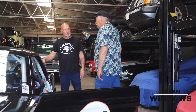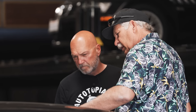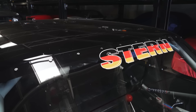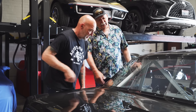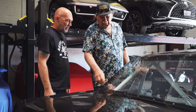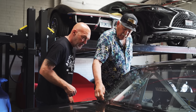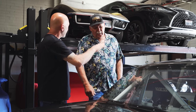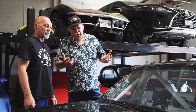And this is all Lexan? Yeah — front and rear. Again for lightening. It's high-end helicopter window material with coatings like fancy glasses, and getting it to look like this was a lot of thought too. I use little spacers in between — each one's a different height to get it to fit right. I added the new-car black trim so it doesn't look odd without it, and little mini radio-control bolts. It's easy to take on and off to some degree. The windows are supposed to be 300 times stronger than glass and they're DOT approved — airplane window, they call it.